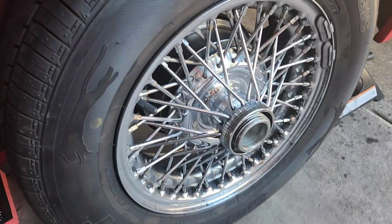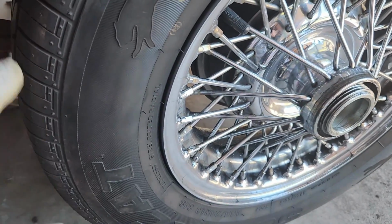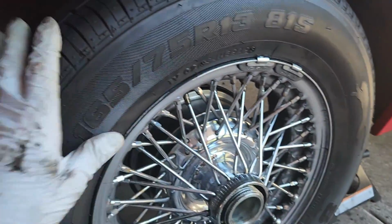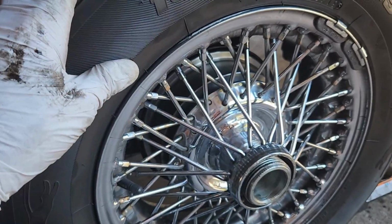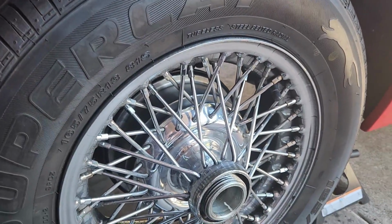After you put everything on, you put the wheels on. You don't have to put the hub nut. That's to see how easy the wheel turns. And if it turns like that, that's absolutely fine, by one hand, freely. Don't expect it to run in circles. It's always going to be a drag. That's fine, for as long as you put about 2-3 kilos of pressure, that's fine.